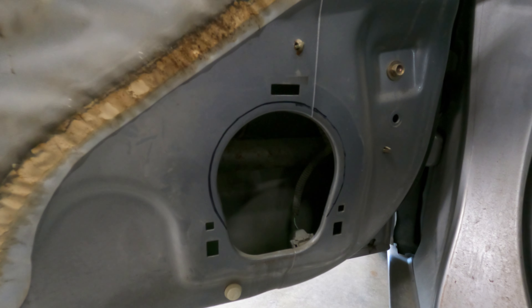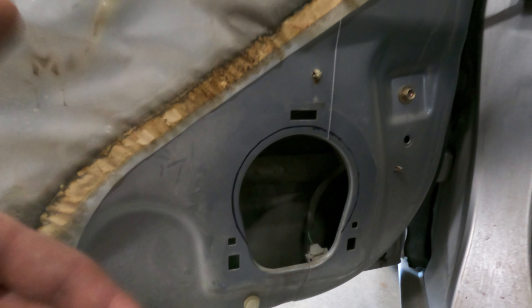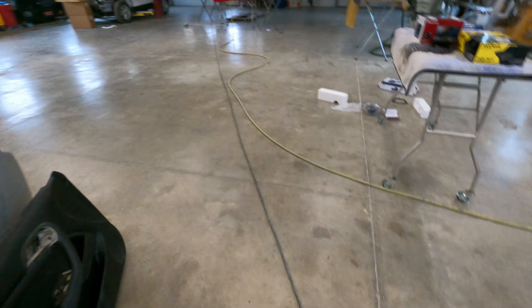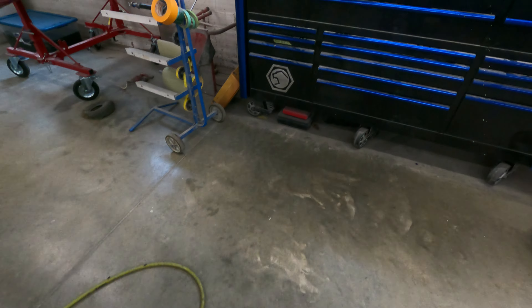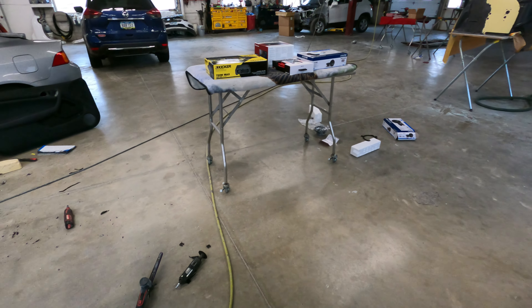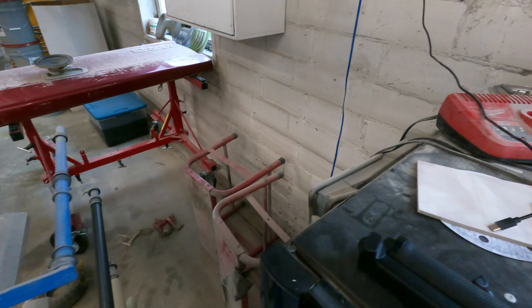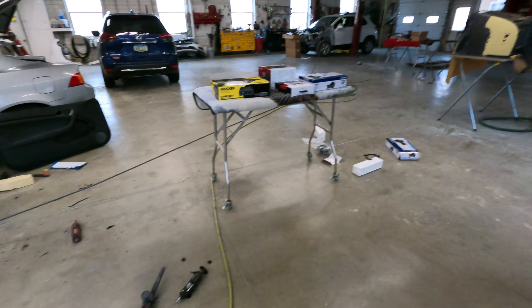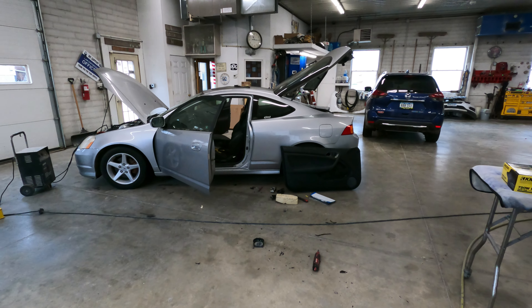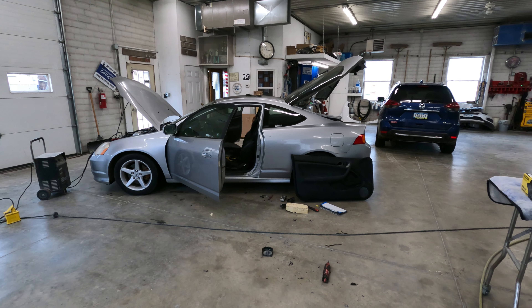Then I think we should be good — I'll confirm the window has clearance, and it should allow it to mount in there and still keep the correct spacing to seal to the door speaker. I'm going to cut that edge and then touch it up with some chassis saver so it doesn't start rusting on that bare metal edge. This is becoming a real pain to fit these six-and-a-halfs in the front door. Should have just made bigger door openings, Acura — what the heck were you thinking?